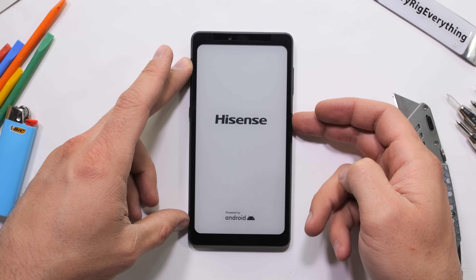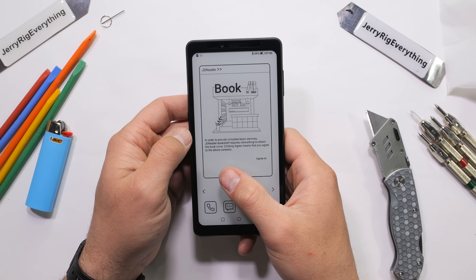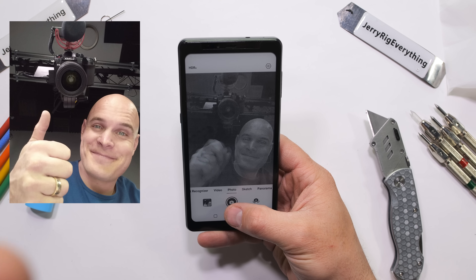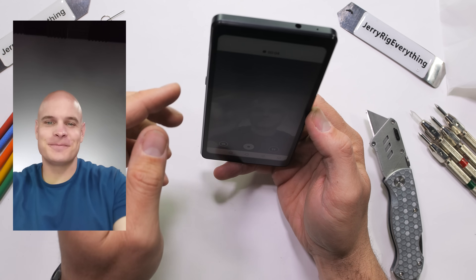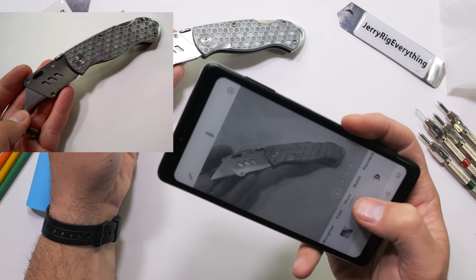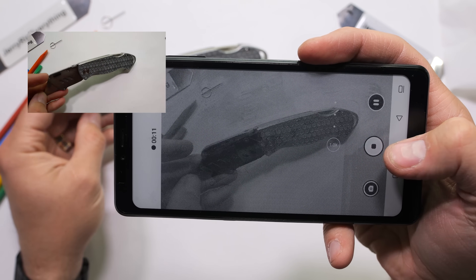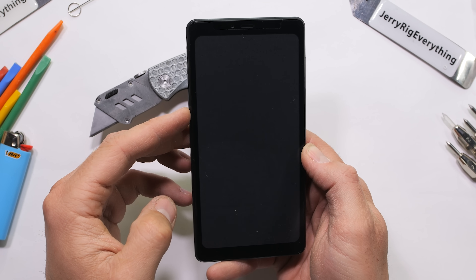Turning the A9 on, the screen dips from black and refreshes while the Android operating system boots into startup menus. Still completely grayscale of course, graphically minimalistic, but it still has a front-facing and rear-facing camera. The crazy thing is, while the camera is showing a black and white image on the phone's screen, the pictures and videos the phone takes are actually color in real life. So if a picture taken on an A9 is sent through text or email, it will arrive on the other end in full color. Another tidbit: since the refresh rate of this display is zero and only flipping pixels that need to be flipped, sometimes the pixels don't entirely flip back to white or black, and there's some ghosting left on the screen. Not a deal breaker — just comes with the e-ink territory. To fix this, there's a dedicated refresh button on the side of the A9 which flashes the screen from black to white to reset the pixels. Quite a bit different than a normal smartphone, but I'm here for it.